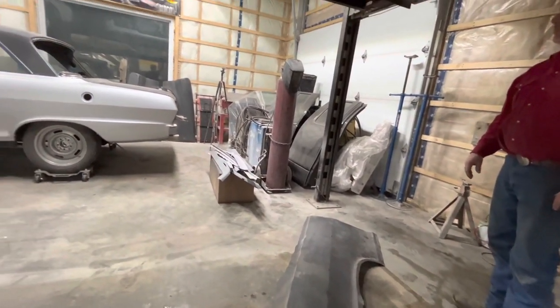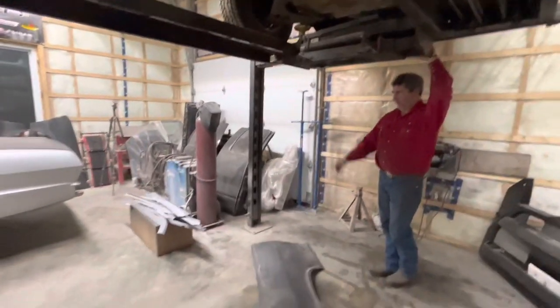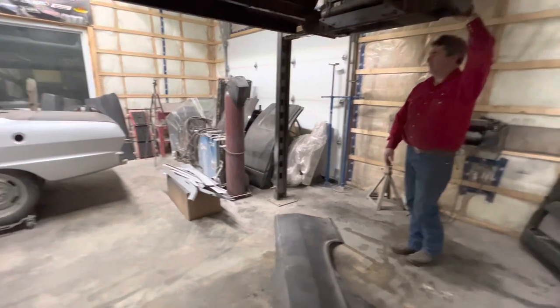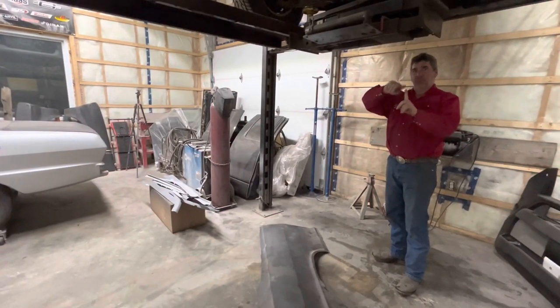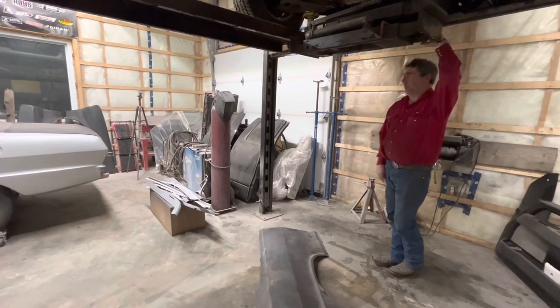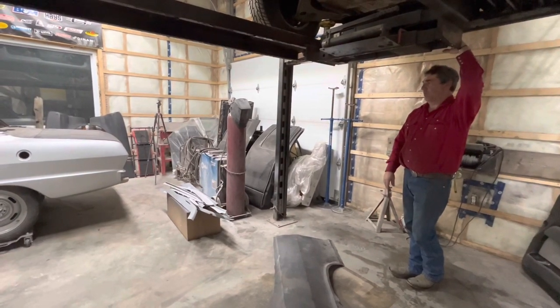We're not doing it for no reason — those quarters are not the nicest I've ever put on, but they're pretty good, they got a good look. The lines aren't as crisp on some areas. That fitment issue by the trunk is not super uncommon — I've had a few of those through the years. You have these compound bends going straight then around the trunk, and those are always hard. Like Billy's '55 Chevy — I had to redo the upper over the tail light; there was just no way that was going to fit perfectly. So I ended up taking the shrinker and stretcher and made a cap. Almost all of them will have some little thing. Along the side of that trunk it's kind of no big deal — I'm not losing any sleep over it. I expected it somewhere. Fortunately, everything fits pretty nice by the doors and the bulk of it is very close — they're not real crooked.